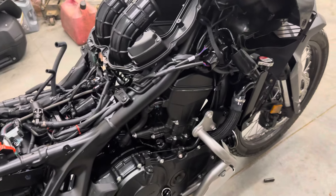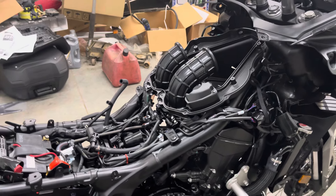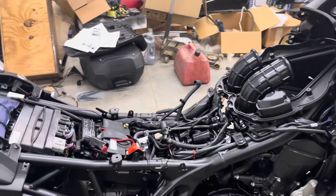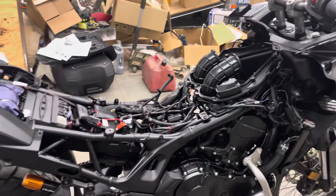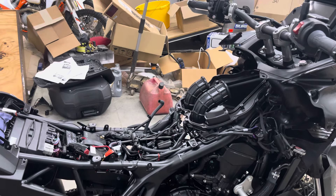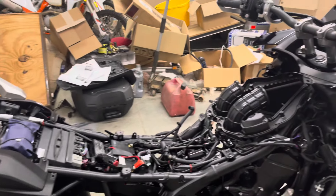I don't know if any cams are different on these versus the European bikes, but I'm not seeing it. I think the part numbers are the same. I want to get the 92 or 93 horsepower with these mods. I don't see why a person can't get close to a hundred out of them — we got 105 over there on the KTM 890. This is doing a lot for a 750, 755cc if you really think about it. I've got a DNA filter coming for this thing too because that looks pretty restrictive. So there we have it.